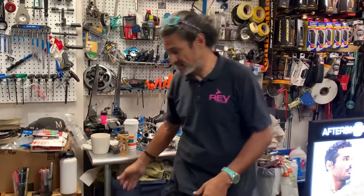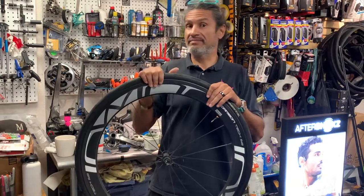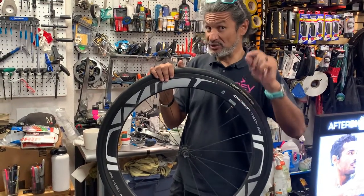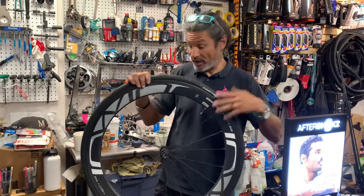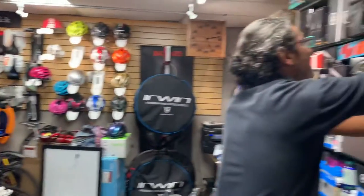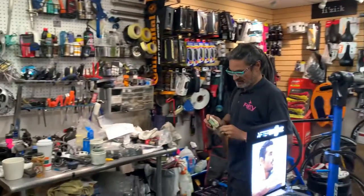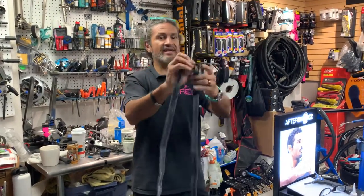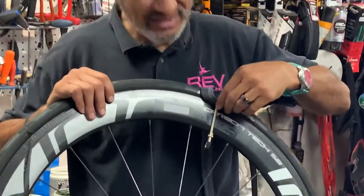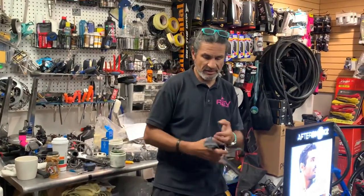Especially if you're riding anything deeper than 58mm — there are people riding 60-plus and 70-type rim depth, especially in the back. If you're the rider on deep section wheels, you should have some valve extenders either already installed on your tube or at least have them in your toolkit. Or find tubes that have an 80 millimeter valve stem. Also, this wheel is set up tubeless, and that's another situation — you need long, long valves for your tubeless setups as well.